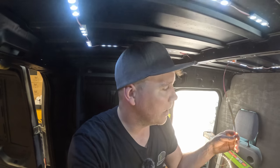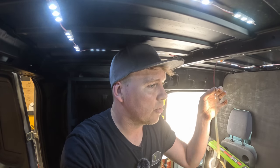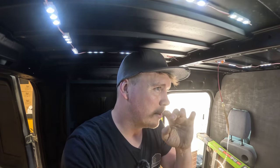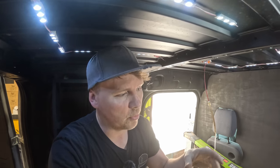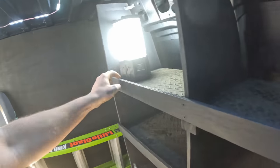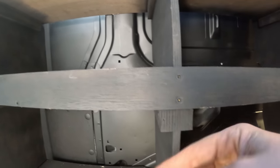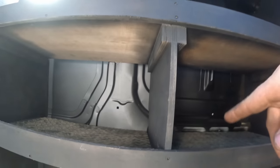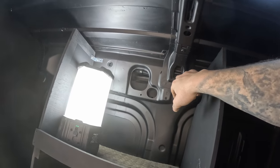So I'm going to start getting that in. I've got my new Dremel gas soldering iron from the last video, so we've been making up some ends and running it across. We've got some bell wire that we're going to start running to places. I think what I might end up doing is cutting the lengths I need and then doing an excessive amount of bell wire on each one so we can put them in place. We will have to drill a hole through here because I'm going to do this as one long length. Same thing here — one long length running through — and then probably two individual lengths so I don't have to drill through here. I'm going to try and feed them all back up into here and then put like a five-way connector, stuff it in there, hidden out of the way, so when the lights come on internally in the van, it will come on, and then we'll move to the van vault one.